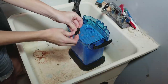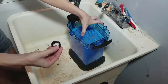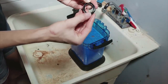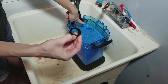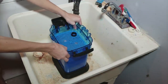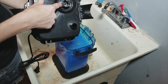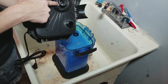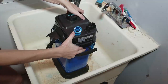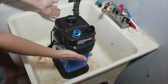The last and most important thing to add inside the basket is this o-ring. This will seal the tubes from the basket to the head of the filter that sits on top, preventing any air or water from escaping. Unfortunately during transit these usually come a little bent, so you have to work them a bit to fit them on the tube — nice and snug. On the inside of the head there's an impeller that creates the water flow, which you occasionally want to scrub down during regular tank maintenance. Line up the head with the tube, add the side locks first, then lock it completely with the front and back locks and we're all set.